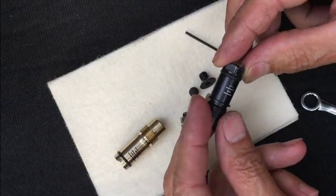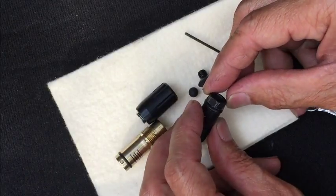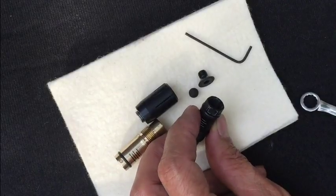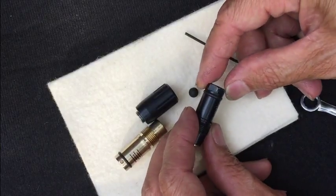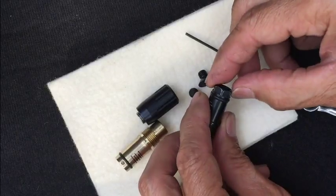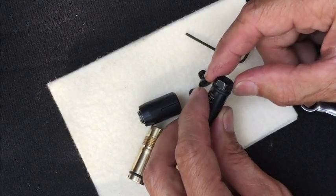There's a hex head on top — usually it's 11mm, but it fits too loose. If you go to 10mm it just won't fit, so it's kind of a loose fit. Even the American size 7/16 would be looser than 11mm. If this was on tight you end up kind of stripping it. Then you end up using a vice grip or something and you snap this piece off the hex head, because this o-ring groove is pretty deep and the wall is kind of thin.